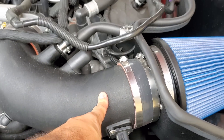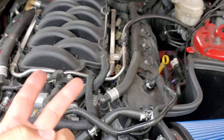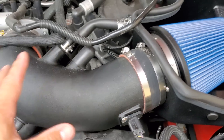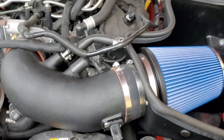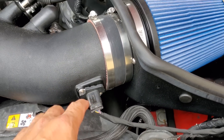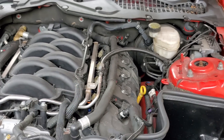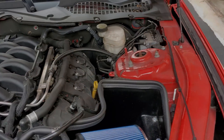If you're going to make a custom cold air, you need to do a couple of things. First, place it in a spot similar to stock. Second, measure the housing exactly — inside diameter — so that we have something decent to start with. Don't make something custom and then get upset because your tuner says it's not going to work. It's going to drive like crap because the MAF sensor dictates everything. The mass airflow sensor is responsible for inlet air temperatures, air load, and signal smoothness — and that smoothness dictates drivability.